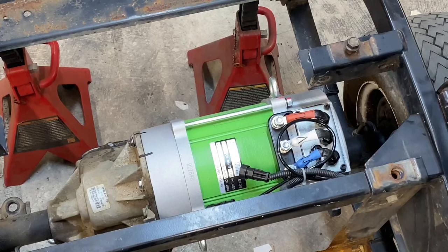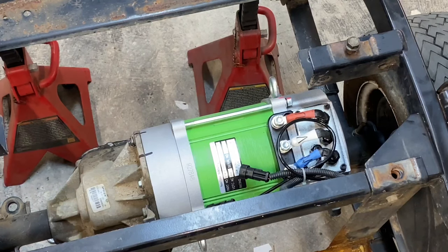All right guys, in this next step, we're going to be running our main cables from our motor to our controller. Now, you can use the stock cables that come in the universal takeoff kit that you can order through us at golfcartsmodified.com. And these are just direct EZGO 48 volt wiring harnesses that you will need to do this kit if you have a 36 volt cart.